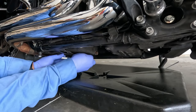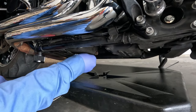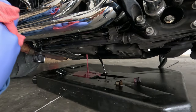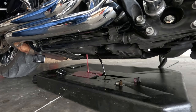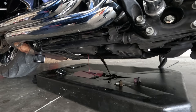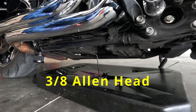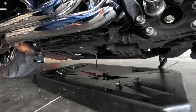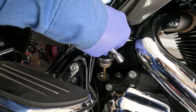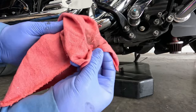One good thing about it — they're both the exact same size, so I'll just make sure I got my rag just in case. Then I come up here and actually crack the cap — just helps it flow. For the transmission plug, it's 3/8 — or not the plug, but where you fill it up at. Of course, here is the oil dipstick for engine oil, and right here is for the transmission. Take these plugs out and check them to see how they look.